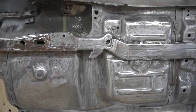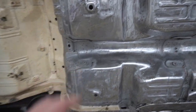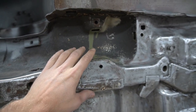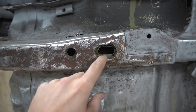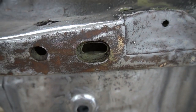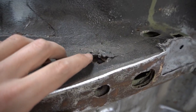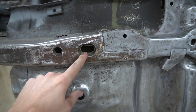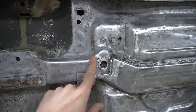All right guys, so the reason I stopped here is because I have some rust in the torque box areas. Basically this area here is fairly solid from what I can tell, except where we got the overlap in metal — you can see that this is pretty much rotted out. And if we look up here, you can see that it's swollen and just basically flaking apart. I didn't realize what was going on here. I did see this stuff before I flipped the car — I thought I'd just be able to cut this out and put a patch in. I didn't really look at this closely, and it's kind of a bummer. If I wanted to replace this whole torque box, I already welded my subframe connectors to the torque box.